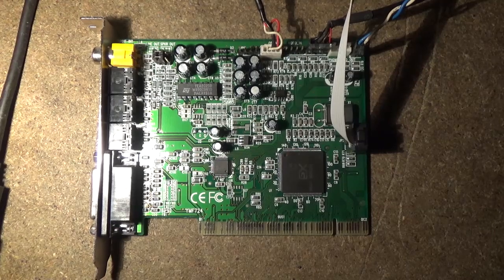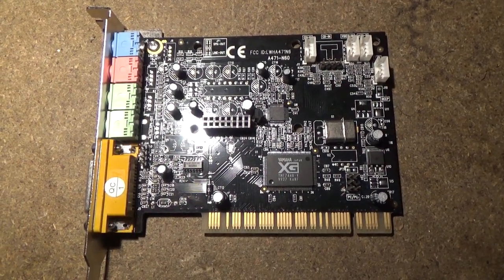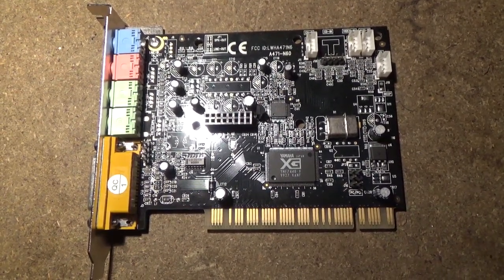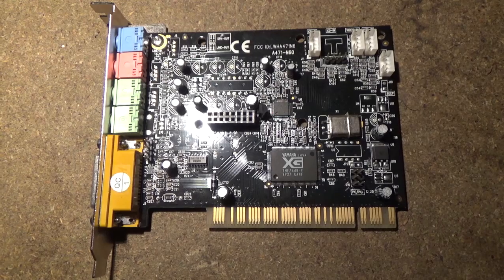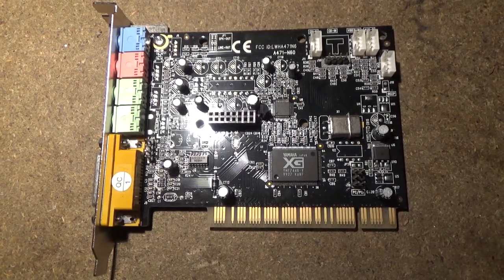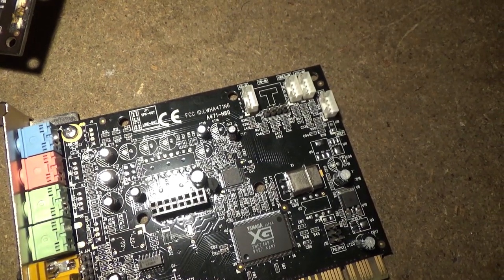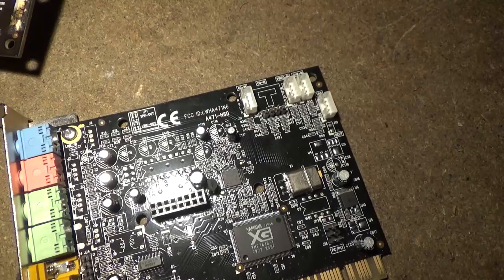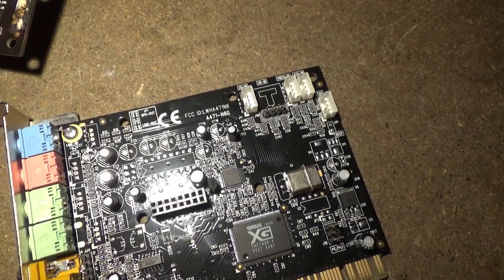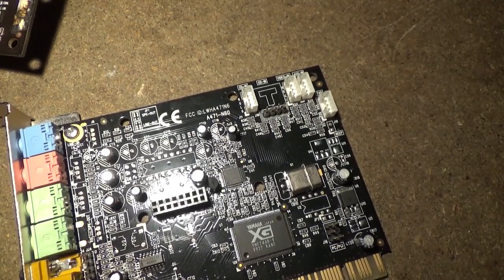Yeah, this fake 744 seems to be a really primitive sample player. In fact, it's about on par with the Dream Blaster, so hell, if you can find one of these and it's cheap, well, I guess you won't need one of those, but you're not going to have any real Sound Blaster compatibility, I guess. The inputs on this fake card also use strange pinouts and often don't seem to work properly or be tied together in peculiar ways. The PC speaker header isn't connected to anything at all, and it's not populated.